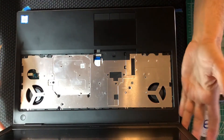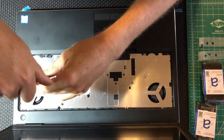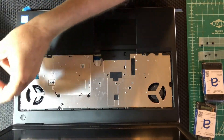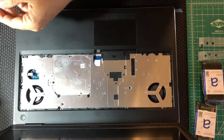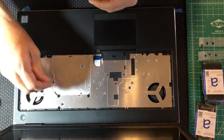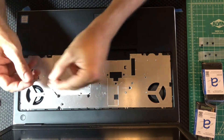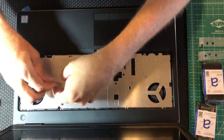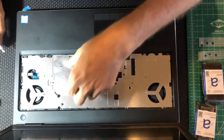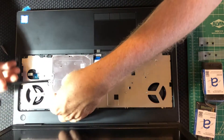With the machine turned back around so the screen is on top, the RAM is underneath this panel held by just one screw — but it has a small tip compared to the others, which all use a number one screwdriver. This one is a triple-zero, which is a little small but does a fine job of removing the screw. I'm putting it on the tape separate from the others so I don't mix it up, then using the spudger to get this panel open.